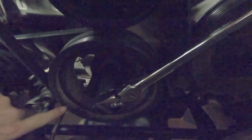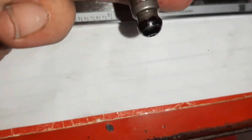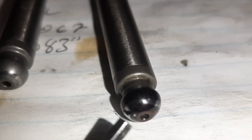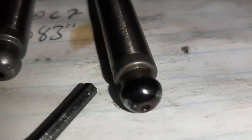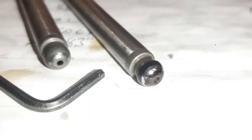I turned the motor over four times with all those parts painted in Sharpie to see the wear patterns. You can see me spinning a pushrod with my finger and identifying the contact patch between the pushrod and the new rocker arm — it's up on the shoulder, not over the ball itself. As the rocker arm goes up and down, it's a little eccentric on the two ends along the rocker arm's axis. I think that's correct; it makes the most sense to me.